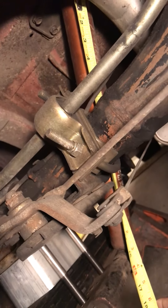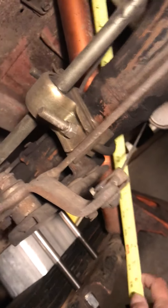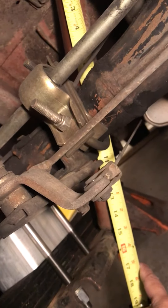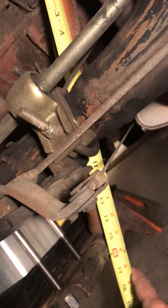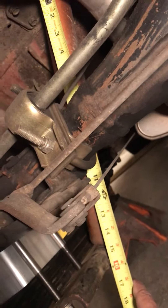I'm going to take that number, subtract it, and from there determine what shock I need. I'm going to give myself a little space and look for a shock that has at least 16 inches fully extended off the body. I could go a little more — it won't hurt — but probably 17 inches; anything more than that isn't really useful.